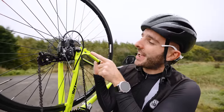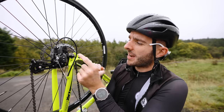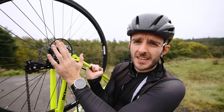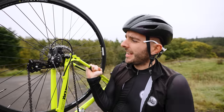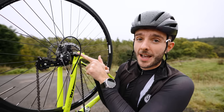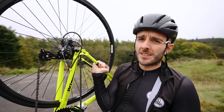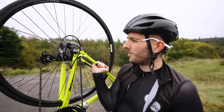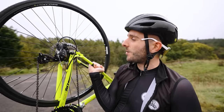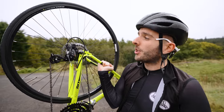The thing I like most about this bike is that it has a replaceable mech hanger. This is a small piece of metal which bolts to the frame and the mech — it goes in between. So if you do crash your bike on the drivetrain side, it's going to bend the hanger instead of breaking your frame or your mech. You just have to replace the mech hanger if you can find the replacement one — Argos probably don't sell them separately but you'll find them online. That's a big plus point, especially at this price point, which previous bikes like the £350 one from Decathlon don't include. If your favourite thing about this bike is that it's got a replaceable mech hanger, that is saying a lot about the rest of the bike.